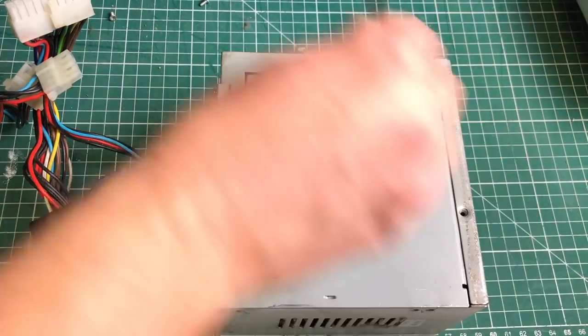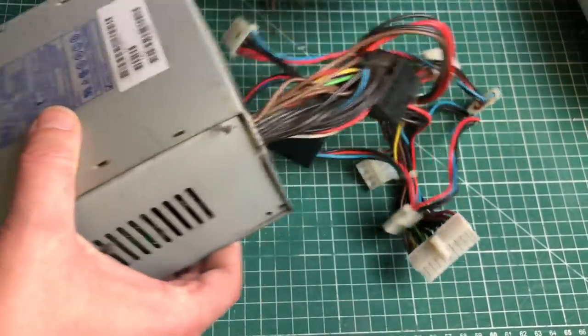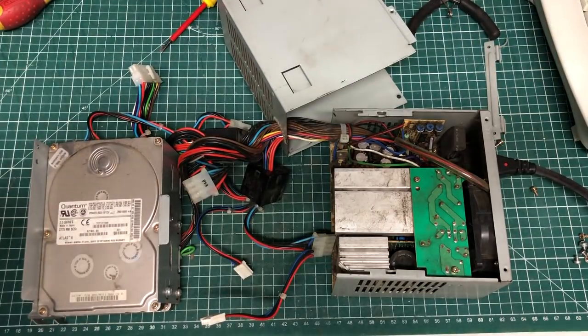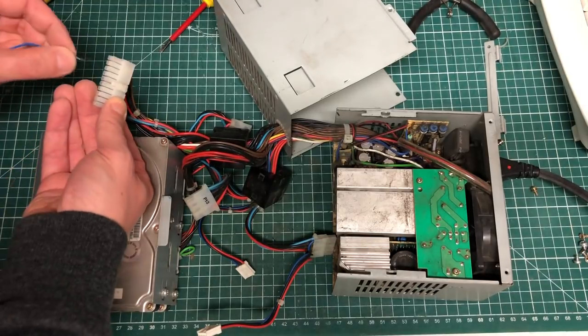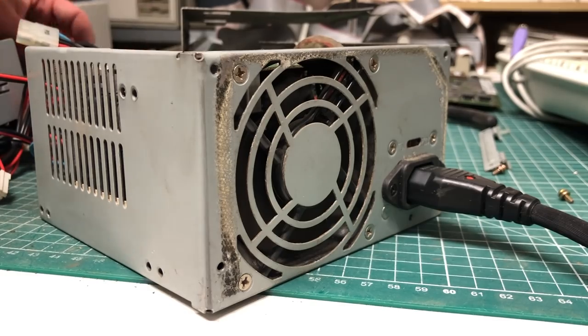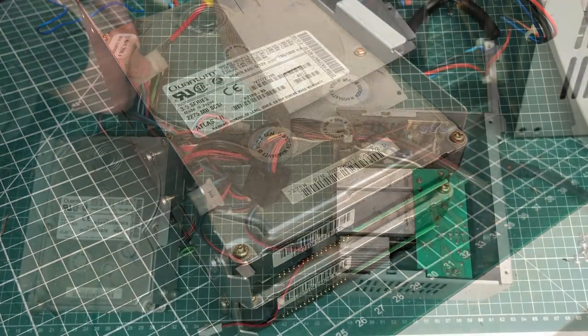My first reaction was to open up the power supply and see what state it was in. I removed all the screws to pry it open, but then I thought why not just try the power supply, hook up a load, and short the ATX pin connector so it will start — because for all we know there might be a problem with the motherboard or the power button. And sure enough, as soon as I shorted the two pins on the ATX connector the power supply fan and the hard drive kicked in, so the power supply seems to be working fine.